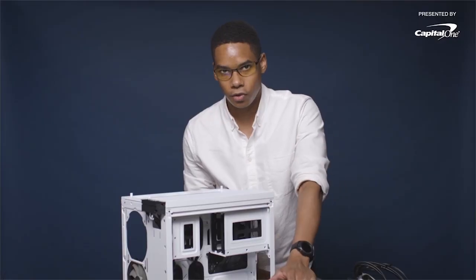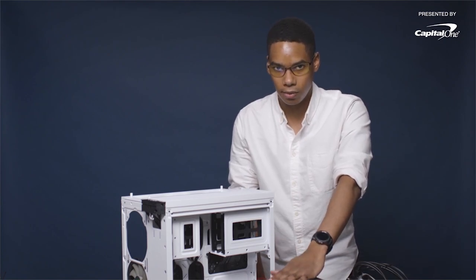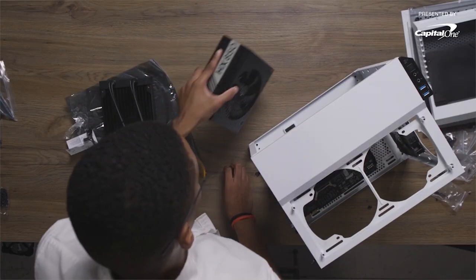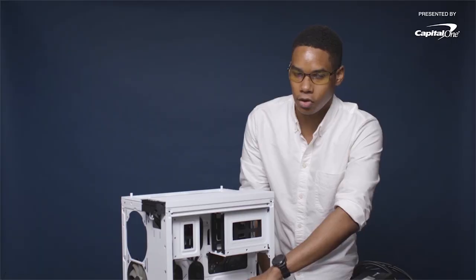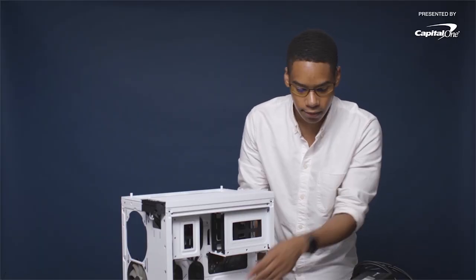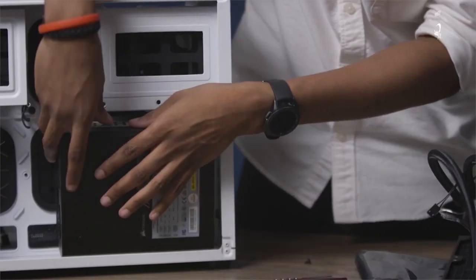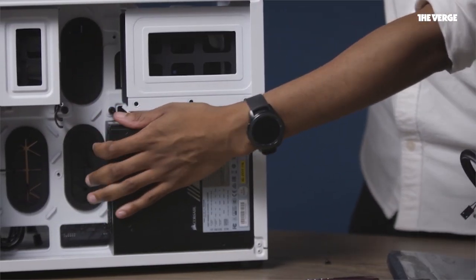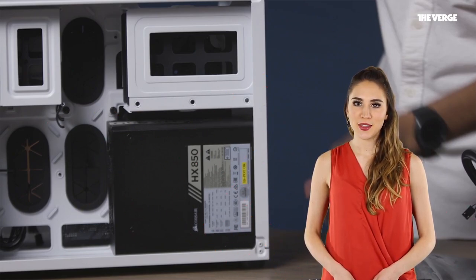Power supply time. I chose Corsair's 850 watt power supply because I need enough headroom for ray tracing GPUs when they come out, and I don't want to have to upgrade it again. All you have to do is take the brick and make sure that you align it with the insulating pads so the power supply doesn't short circuit and come into contact with the rest of the system. Slide it in nice and easy until you have a snug fit, and then shift it to the back against the frame. Note: this case has vents on the back case panel meant for the PSU — what he is doing is restricting airflow to his PSU.